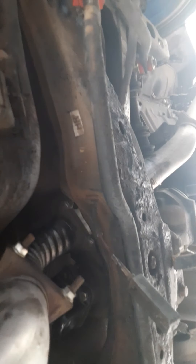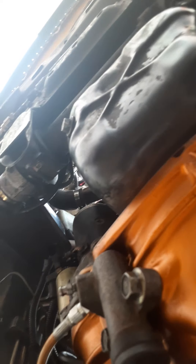See that old short throw up there. Let me get this thing finished up so I can drive it tomorrow, and I'm going to make some better videos. I think I need to do a little more painting under here. Sway bars are next — sway bars will be pulled off and painted. Everything else looks good. And then all the bushings — I'm going to probably pull them off and paint them copper. I'm going to have to re-tap this hole here. It ain't giving me a problem yet, but I don't like how the bolt goes into it.